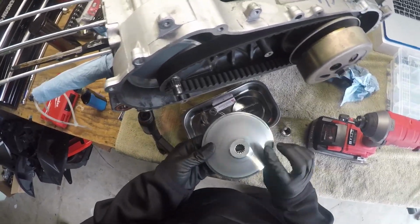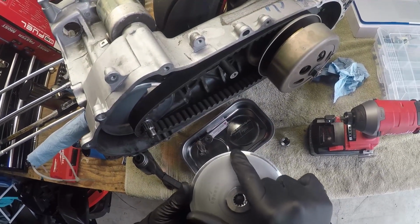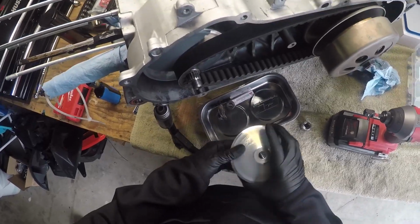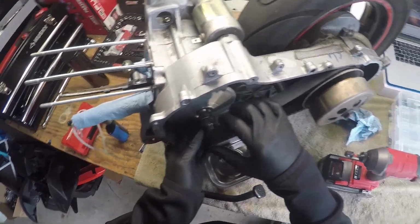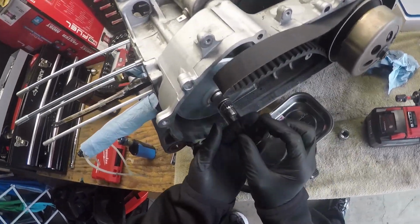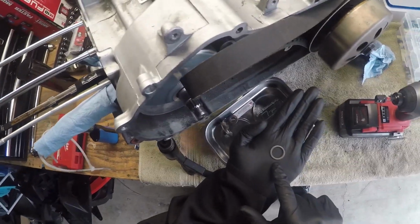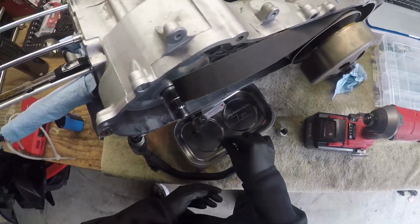Right, that's the top of the variator. Ooh, look at that. I need to tune this because it's not going to the top. TST variator. Okay, loosen up the belt a little bit. Get the belt out of the way. There's a washer right here. If you have a stock Zuma 125 or stock 50, I removed this washer and it gave me an extra 5 miles an hour.